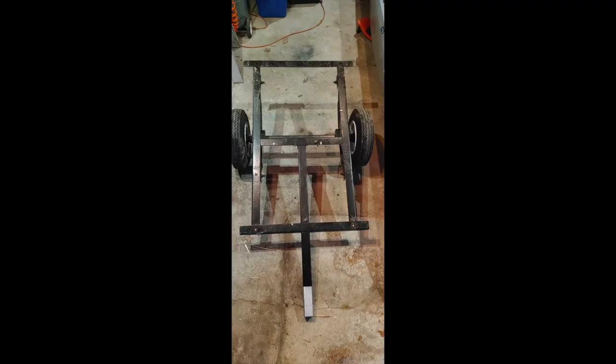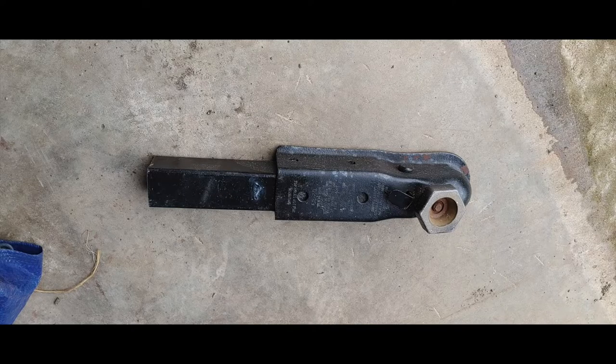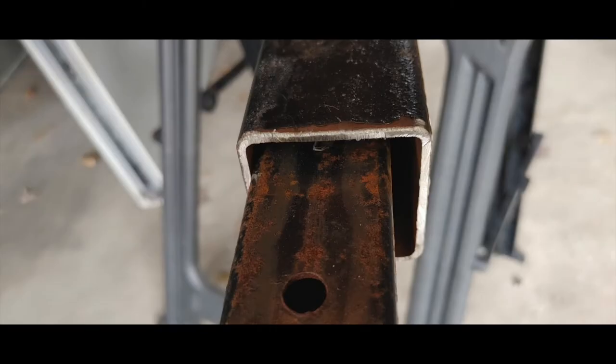Here's a picture of the bare frame. I had to lengthen the tongue, so I cut off the front hitch. You can see that there to reinforce where the new tube would be added to lengthen the tongue. Since I didn't want to weld it — because I may convert it back in the future to the motorcycle trailer — I put a piece of smaller steel tube inside the two-inch steel tubing on the frame.